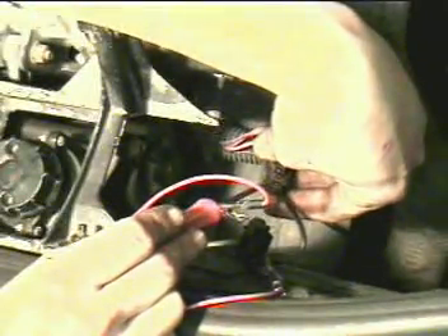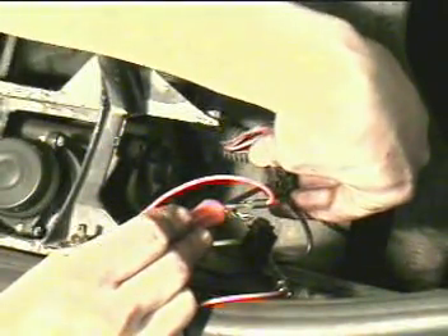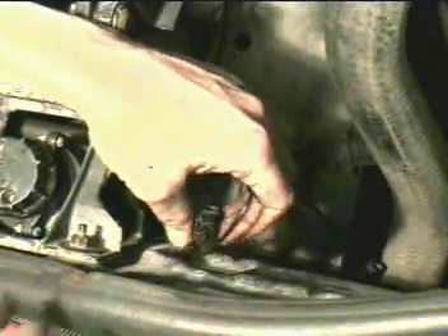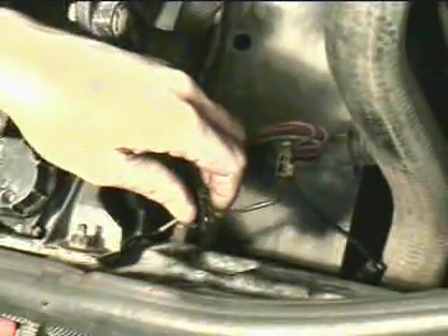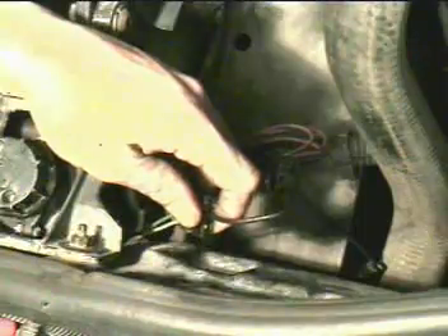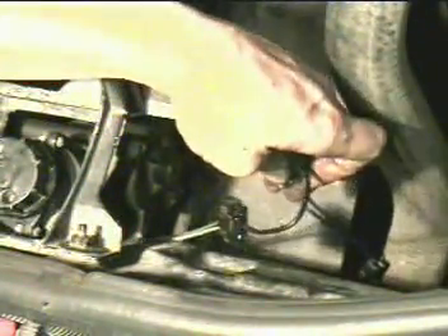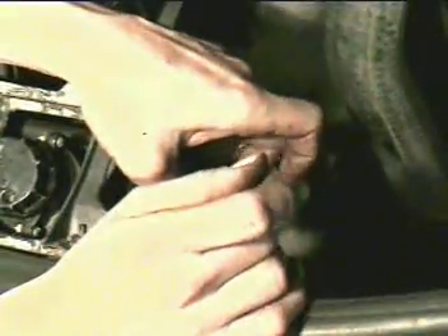I'm going to probe the red wire and the motor should come up. The motor came up. So now I'm going to unplug everything, because the green wires and the gray wires switch their positions for the up and down motion. So I'm now grounding the green wire. The black wire is still connected on the three-prong side, but on the motor side I've now stuck my ground jumper wire in the green wire slot.